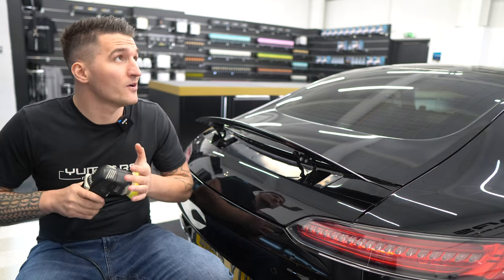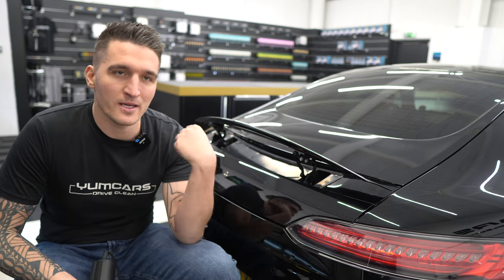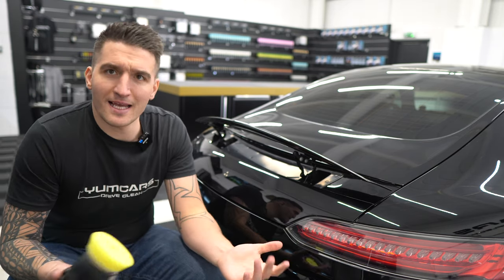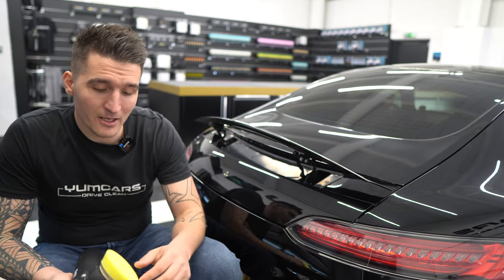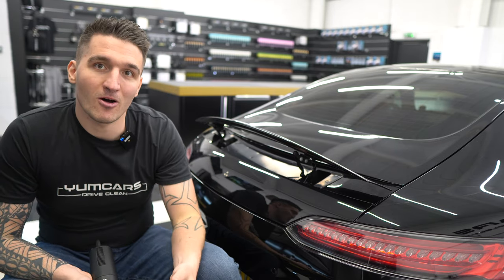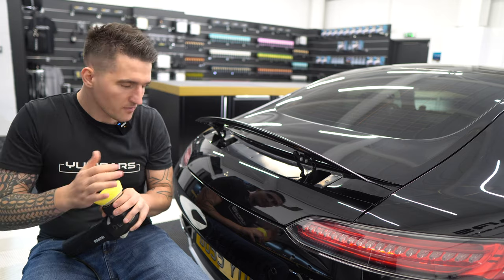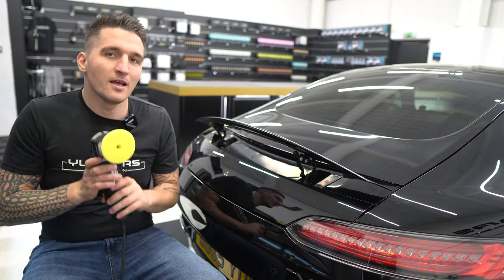The Rupes yellow pad — it's not their softest; the softest color is white. This is a completely fresh pad, a little bit firm — it's a light polishing slash finishing pad. This is where you really need to start gaining experience with time on actual paint, because it depends on the paint you're working with. This pad is classed as a finishing pad. Very rarely do I come across a car paint where it causes its own little micro-hazing, but if that does happen you just switch to a white pad. This paint is hard so this will be an absolute beauty — it's just got that bit of firmness that gives enough rigidity and backbone when I need to put a bit of pressure behind it.